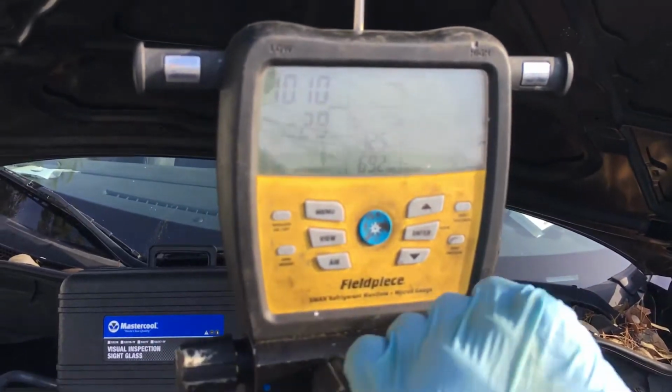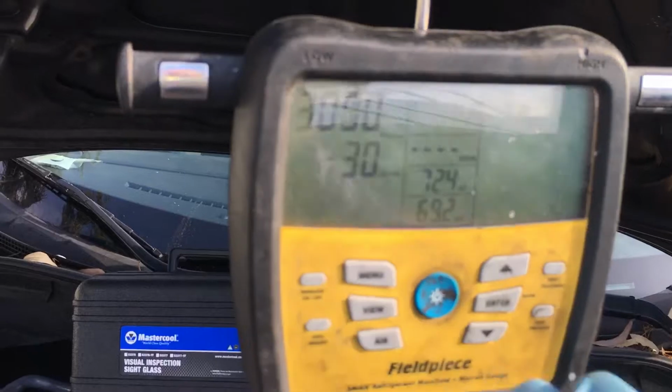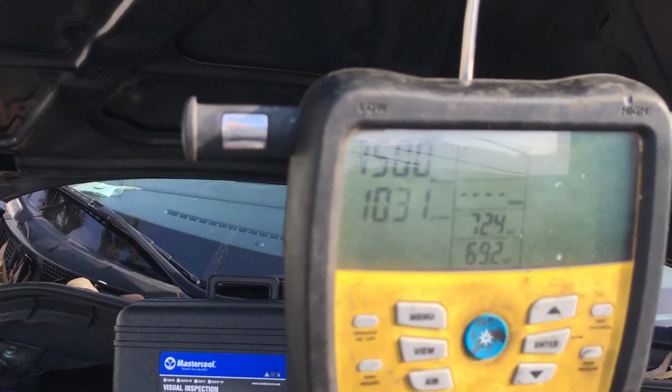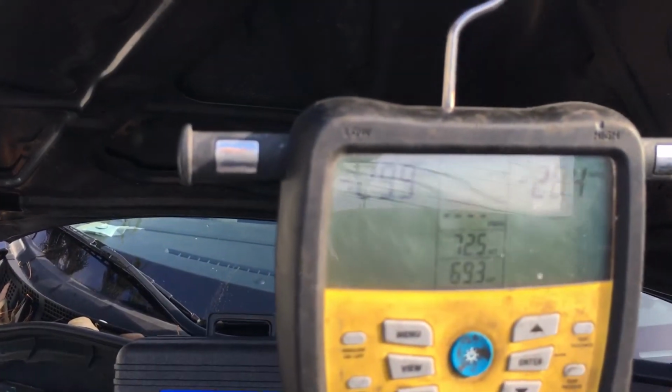Let's see. Watch this. Let me turn off the vacuum and watch the microns. Boom. We went right over 3,000 like that. So it's not moisture, it's a leak.